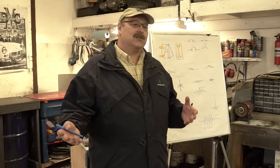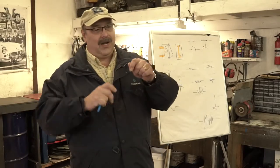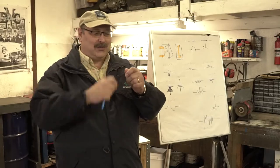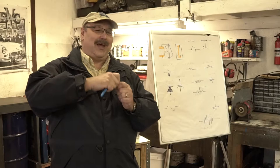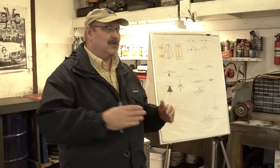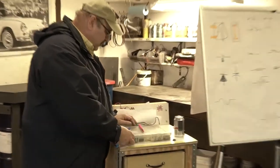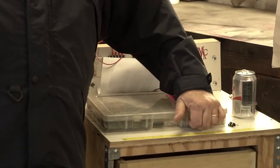Under a subheading of conductors, you've got the connections. One of the biggest things we see is two wires twisted together with a band-aid for insulation, or two wires twisted together with a wire nut. I had a car come in with the factory wire connected to a piece of Romex house wire — a single conductor wrapped around with tape on it. Anytime you make a connection you're adding resistance, so the best way is like the original harness — source to source. We have all the factory original connectors, including the bullet connectors, and the important part is we have the correct tool to crimp those on.